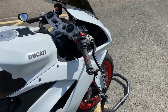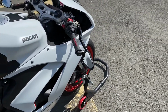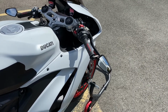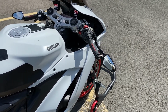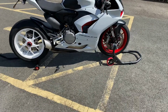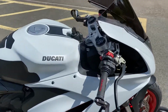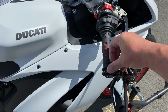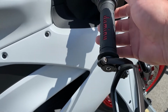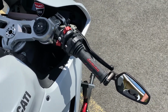So what I did was, I got a bicycle pump. I put a straw, the straws from the WD-40 tins, and wrapped some masking tape around one end so it was slightly thicker, so I could slide it over the bicycle pump. When I locked the pump onto it and pumped, it actually squirted air out. Then I put the tube just up this part here. I peeled the original grip back, put the airline up there and pumped it up, and it expanded it, and I got the original grips off easy as pie, guys. They came off super easy just by using a bicycle pump.